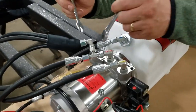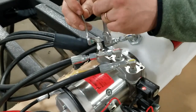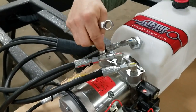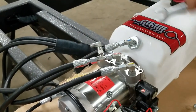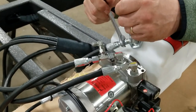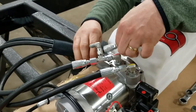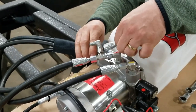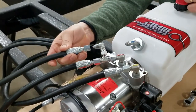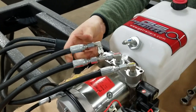Taking your two wrenches, the first thing we're going to do is go over to the cap here. The cap is a 9/16. Using your other wrench, remove the cap off this fitting right here — this is the 90 degree elbow. And on the return for the air breather here, we're going to use our 9/16 and our other wrench to remove this hose off the return breather. Then take this breather hose and put it onto this 90 degree elbow and snug that up.